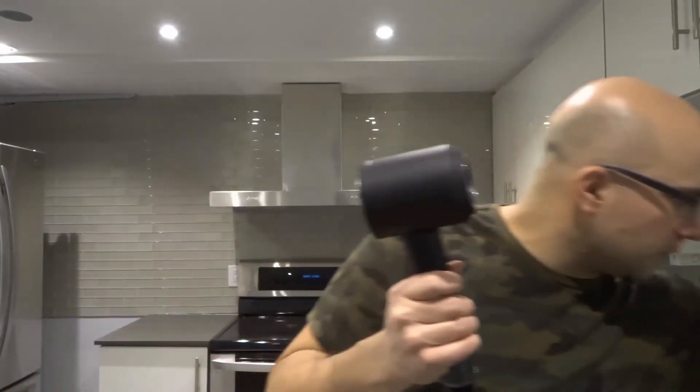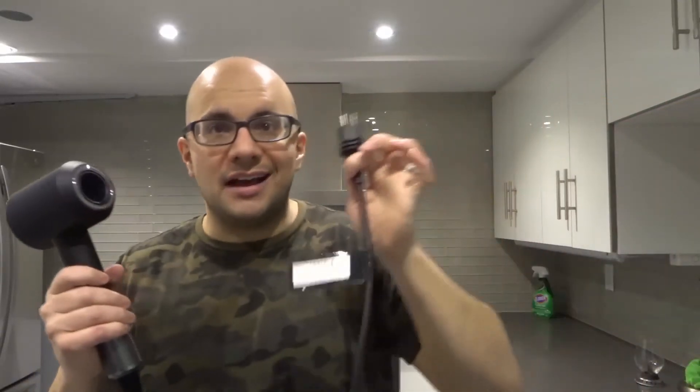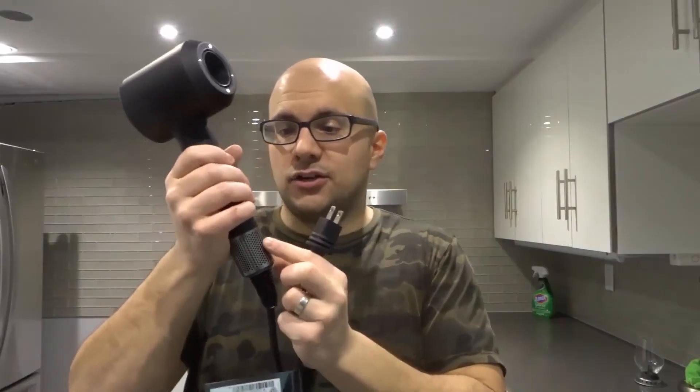Also, a random side note: be sure to clean the filter every so often to make sure that not a lot of dust accumulates on that filter cage, because it will obviously affect the actual capabilities. If there's a lot of dust, it's going to be hard for it to get enough air. And before you clean the filter, make sure that you unplug it. Before you put the filter back on once you've cleaned it, make sure it is completely, absolutely bone dry — not even the slightest bit moist.